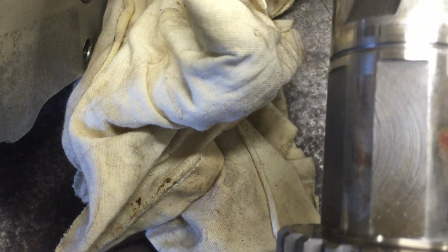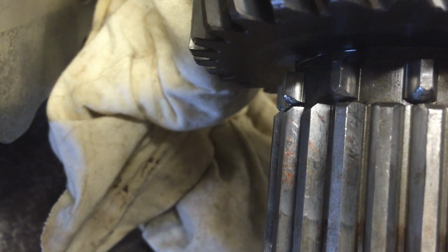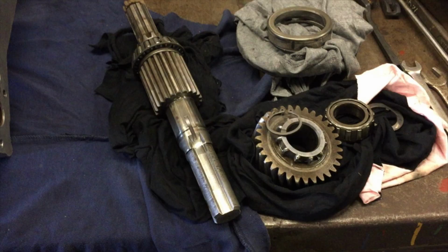And the key thing here is when we grab this high-speed wheel, where this sits on the output shaft, comes in here and sits here. The gap in here, when this is all together, is supposed to be between 0.15 and 0.2 mil. Mine was 0.28. So we're going to, as I said, change the thrust washer. We're just going to check it all now before it all goes back in, so we don't have to pull that back out again. So we're back on a couple more images as we get ready to put everything back together.